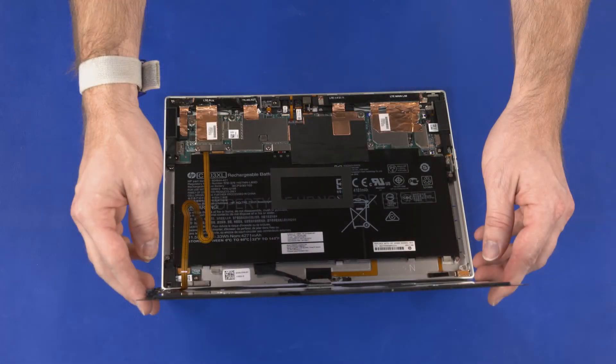Perform the following before proceeding with the assembly: ensure all components are intact and in place; ensure all screws are tightly screwed; ensure all cables are properly inserted; ensure the wireless antenna foil is flat; ensure the touch screen board is well attached; ensure that there is no metallic debris attached to the magnets. Power on the tablet and ensure it boots and that there is touch screen functionality.